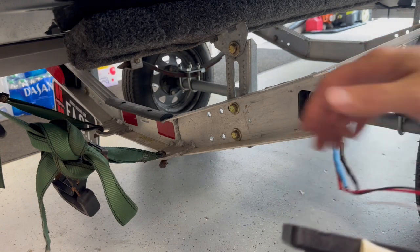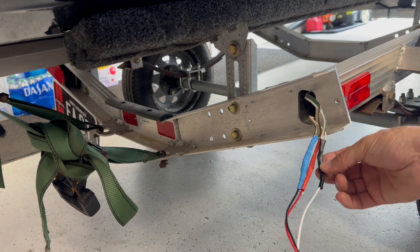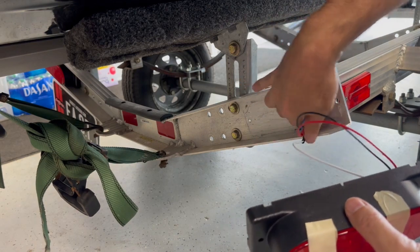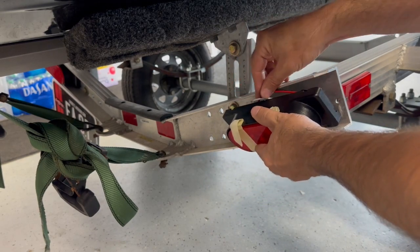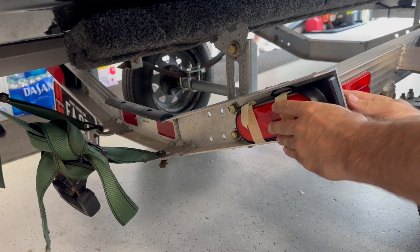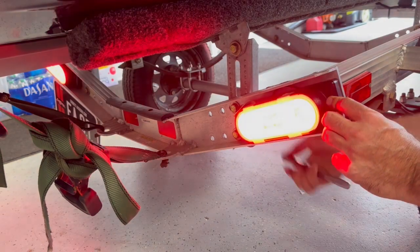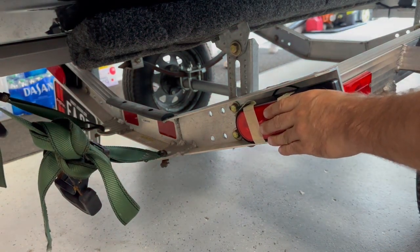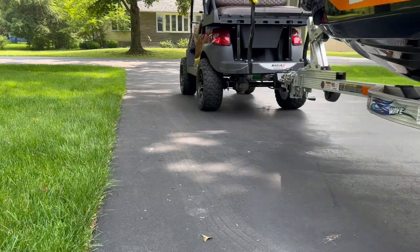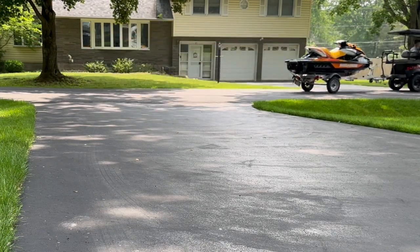I got the right side wrapped up and wired in. We got some shrink wrap done. I have the wiring connectors heated down and then I put some additional shrink wrap on there in an effort to keep the water out of these connections. That should be good enough. Then we'll just get this thing bolted back in. That should do it. I did test them — looks good.